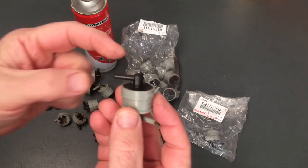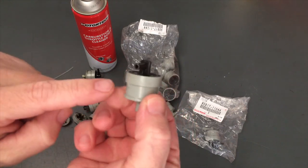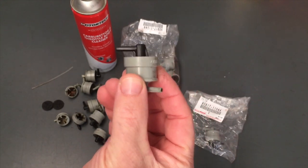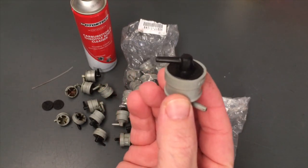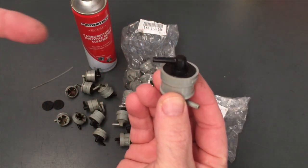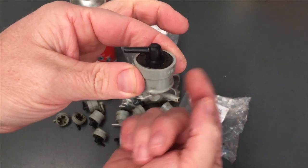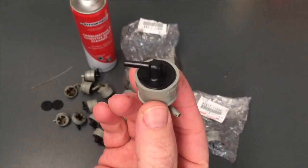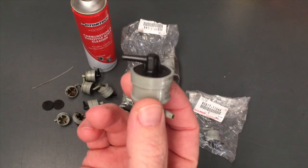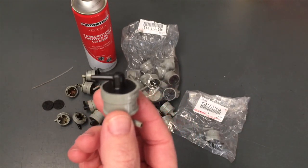On a 1KD, the black goes to the top. Black goes to the top when you're refitting, in case you forget. From the passenger side of the vehicle, the best way to describe it is black to the top, to the left. Your top vacuum line goes to your sensor and the bottom one curls around in a U-shape to your intake. This might help if you've pulled it apart watching our full EGR intake clean video.